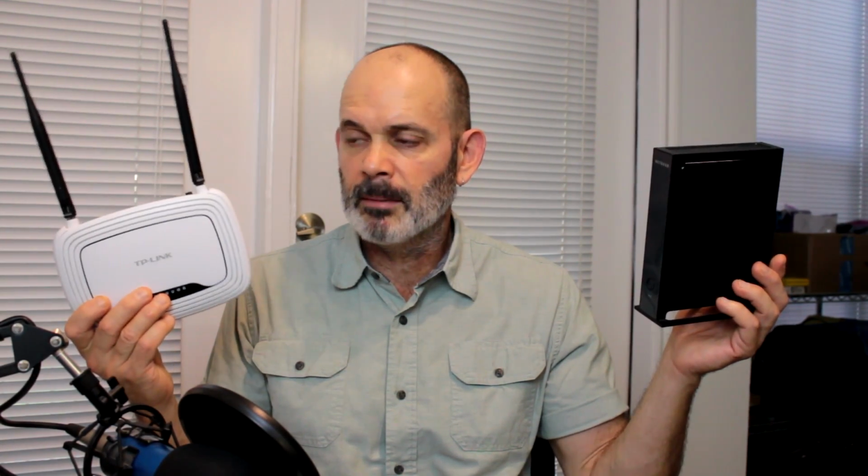So in order for this to happen, your secondary router has to have WDS. Well, at least if you're going to follow this video and have it happen. WDS capability. The primary doesn't have to have it, just the secondary. So if you have a router that has WDS and you want to connect it to any other router, you can do that by following the instructions in this video.